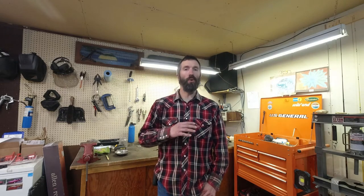I'm Zach Eastwood. So the next project on the Land Cruiser is we're going to do a de-smog on the engine. Another thing that people call that is an EGR delete. It's just a way of removing the old emissions equipment that is worn out and clogging up the system. And I'm hoping that it will increase some of the performance. If I can just get a little bit more pep out of the engine, I feel like it would really help things out a lot.